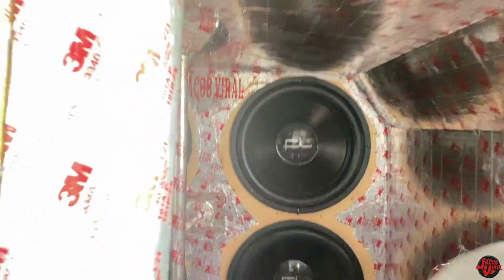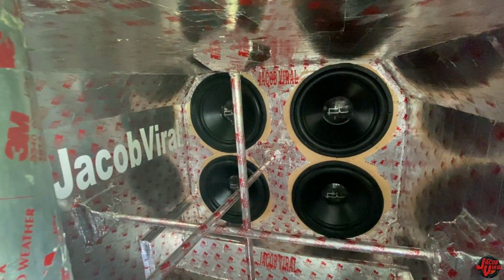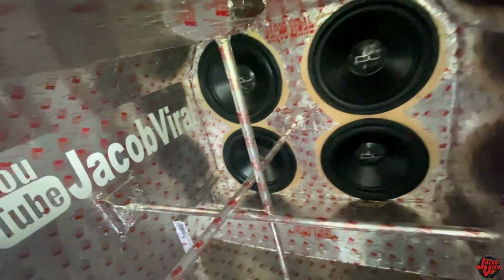Yeah, that's definitely brutal. So that was a 48 to 50 hertz range frequency tone. I built this enclosure to be around the high 40 hertz range to be really peaky, and it definitely, just for that single amp, would be blocking this port, help me load right because of the seats usually here. So I'm really excited to see how it does when I get some power on it, and of course I do some break-ins and tests. A lot more to come.